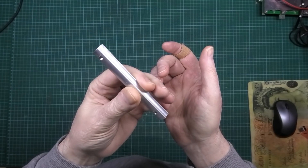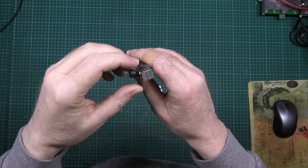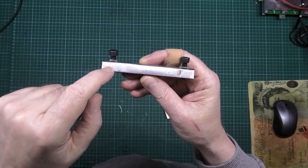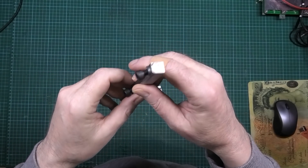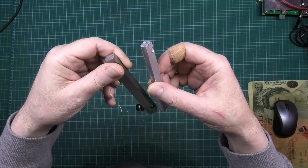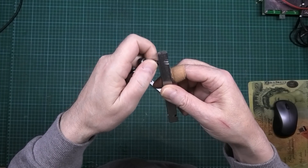That's literally all that holds you and the seat together. So I've made these steel ones. This used to be 12 by 12 but it's now 11 by 12. I had to cut one millimeter off that side, which took me three days to do - steel is not easy to file. They go in at the same angle as the originals. I've already done the other one, and now I'm going to fit this one so I can torque the seat down to the pressure I actually want.